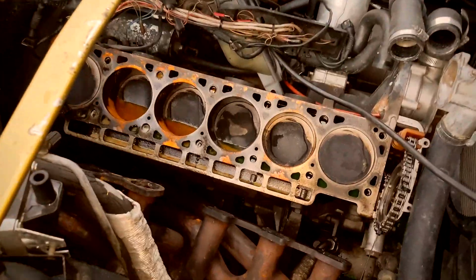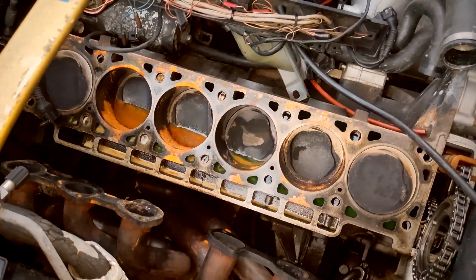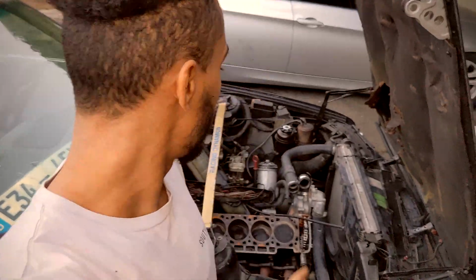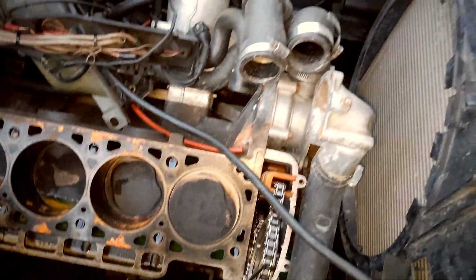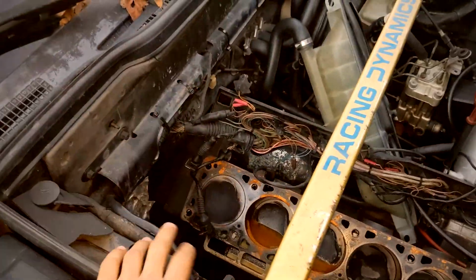Worst case scenario, I was just gonna steal the oil pan bolts that are on this block now holding the oil pan, since the block is coming out anyway, but I did find the correct bolts. I'm glad I'm done with that part because I would say that's the most difficult part of this whole job. I'm gonna get under here and disconnect the transmission, disconnect the motor mounts, the AC bracket, and I believe the power steering bracket so I can pull this block. But that's all easy stuff.